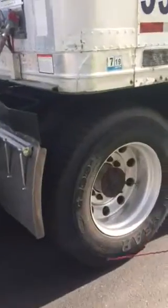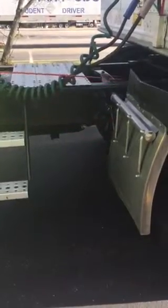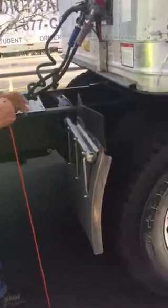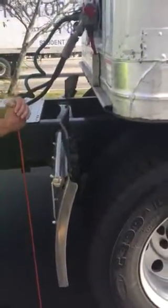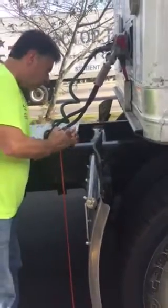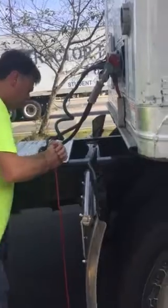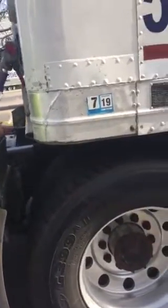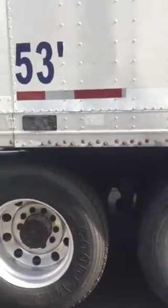Now I'm going to move into my suspension system again for the second time. My leaf spring mounts and U-bolts are not bent, cracked, or broken, missing nuts, bolts, or screws. My leaf springs are not bent, cracked, or broken — they're properly aligned. Any more than a quarter of any leaf missing places the tractor out of service. My shock absorber is not bent, cracked, or broken, missing nuts, bolts, or screws, and I see no leaks. My airbag mounts are not bent, cracked, or broken, missing nuts, bolts, or screws. My airbags are not cut, cracked, dry rot, or bulging, and I hear no leaks.